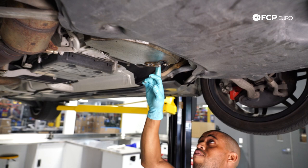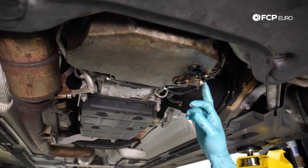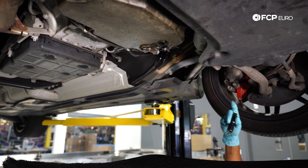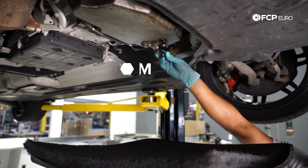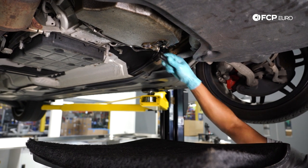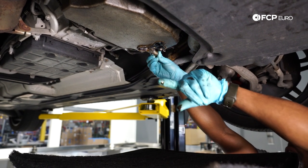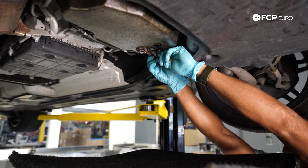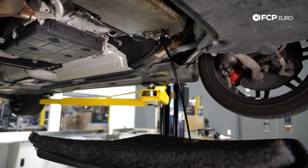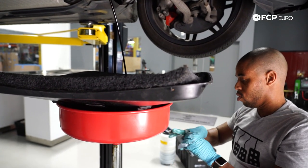This is our oil pan — it's pretty obvious we've got some sort of oil leak going on, so we'll need to investigate that. But for today we're going to focus on changing the oil. This is our oil drain plug — a 13-millimeter drain. When it comes out it's going to want to shoot out towards the driver's side of the vehicle, so we're positioning the pan accordingly with a nice wide mouth over the drain. As I'm unscrewing it, I'm pushing in the direction of the passenger side to control the flow, and then I'm just going to pull it away.